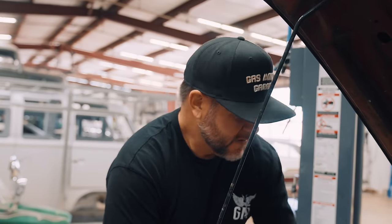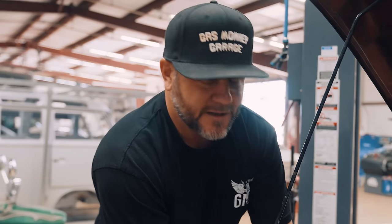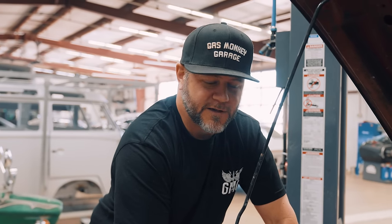Originally this car was an EFI car, so I had this regulator here that was regulating the fuel pressure down to 8 PSI to go into the carb, because I still have the stock fuel pump in the tank. Right now I'm just taking all that off because the Holley Sniper is going to come with its own regulator, and I'm using a fuel pressure pump that's for EFI. Don't have to use this anymore — always trying to lose weight.